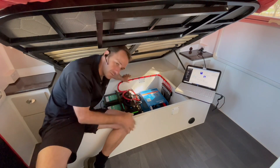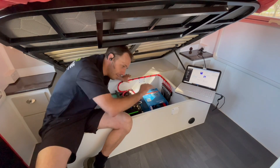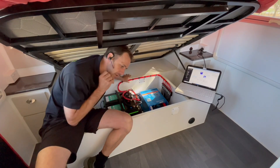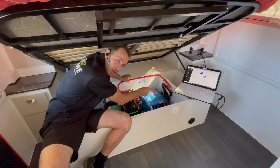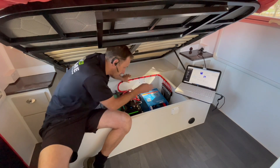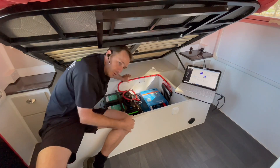We've rewired this one again. It had chassis-mounted battery boxes — absolute mess as they all are. Blade fuses on top, covered in dirt, really horrible. This is how I like to do it: running all the midi fuses up there, keeping it all on the high current side of things with thick cable. All labelled nice and easy to read.